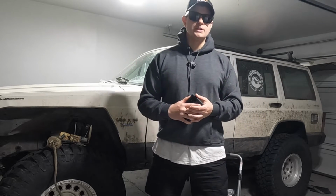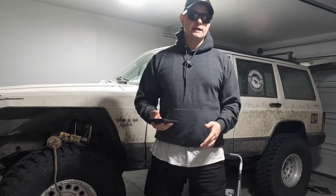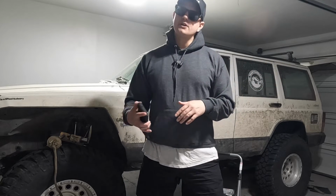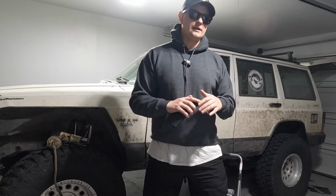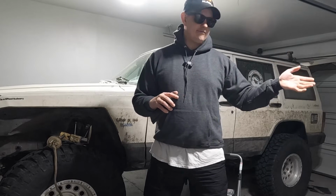Typically, I recommend people reach out to the manufacturer and figure out what's best for them. But that's the second category, 1.5 to about 2 to 2.5 inches. Now, these are going to be a medium install difficulty. They're going to be typically a little bit harder than just the small basic spacers that you put on top that are 1/2 inch to 1 inch.